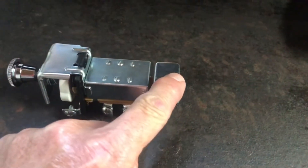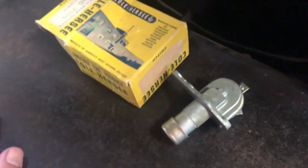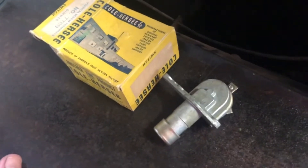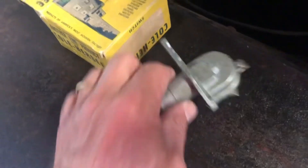This part says 12-volt on it, but of course we're using it on six volts. When you double the voltage you cut the amps in half. I've calculated it up — with all the bulbs it's not going to draw but somewhere around 20 amps, at least based on what I found on how many amps headlights draw.